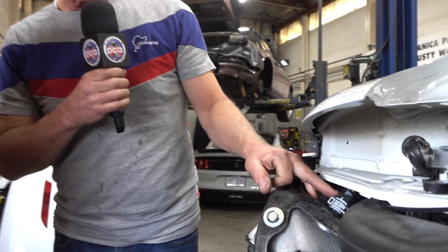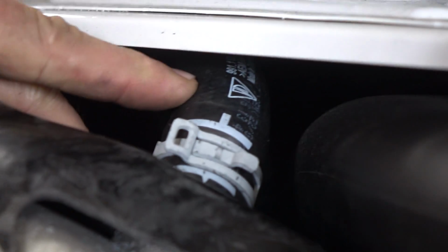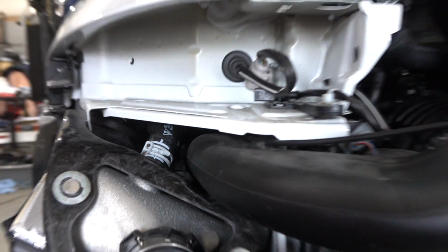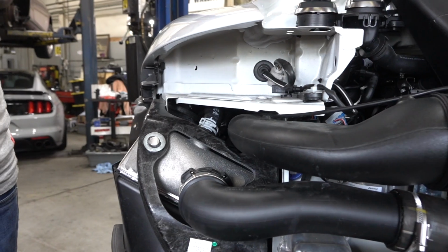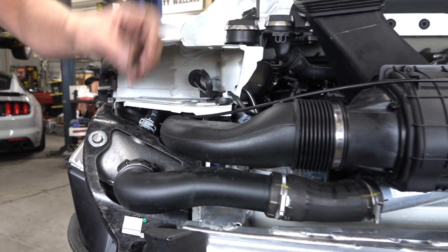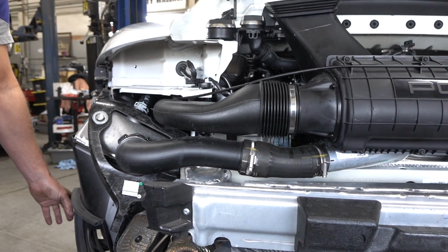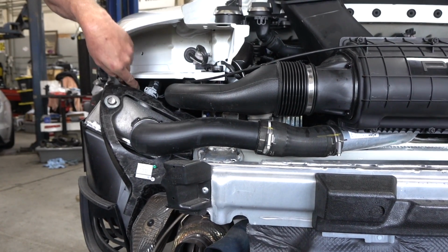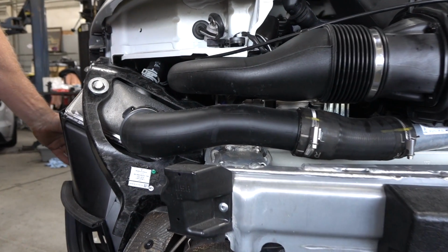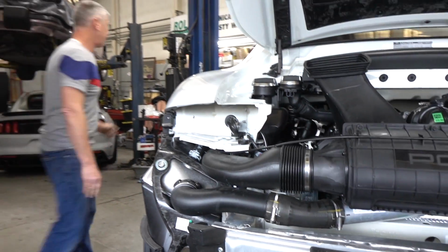The compressor bypass valve comes off of the intercooler assembly. What this compressor bypass valve does, every time you're shifting a gear and the throttle plate is opening and closing, the air at high pressure always wants to seek a low pressure, which is the intake valve. When you shut the throttle plate, this high pressure has got to go somewhere. Typically, it would go back into the compressor section. That would overheat the air that would come in the next throttle opening. What they do is they bypass the air. It comes back around to the compressor section inlet to stop the heating of the air. Everything on here is motorsport. Wow. All right, let's get it back up in the air.